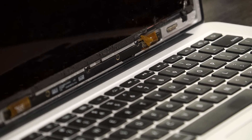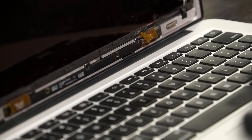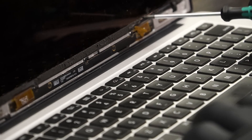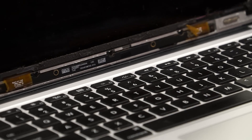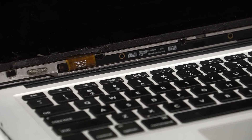Here's the part where you get to realize that I unplugged my microphone for a short period of time, so I'm overdubbing. You saw my lips moving and didn't hear anything. So this is the part that really sucks. You may think there's only two screws over here — there's not, there's seven. You know why you can't see them? Because Apple decided to cover the screws with black tape. They covered a piece you need to remove to fix this properly with black tape that looks like nothing's there. There's a Phillips screw behind there.